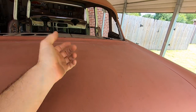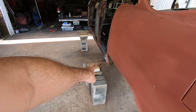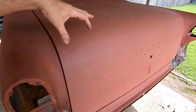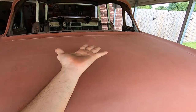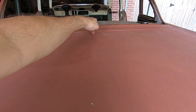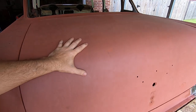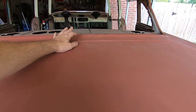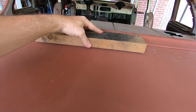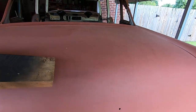I turned it upside down and had two sections of four-by-four pieces of wood laid down on the ground — one running across this side and one across there. That way it was upside down leaning on the top edge. I basically stood my whole body weight right in the center of that deck lid and gave it a little whoop. When I put it back on, it had come up a little bit higher right here in the middle. At that point I took a two-by-four and a dead blow hammer, stuck it right at that edge, whacked it, and it actually got it down pretty even. So you have to tweak around on these deck lids quite a bit — this is how you make stuff fit.